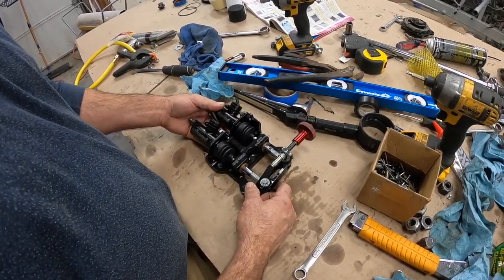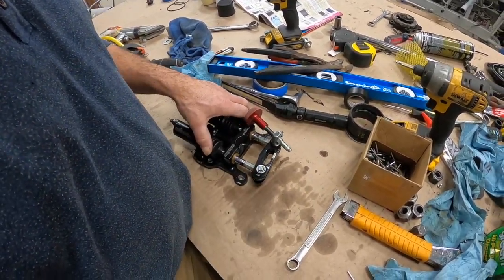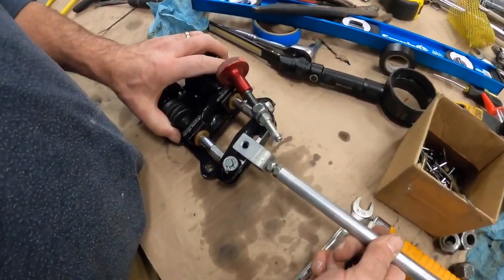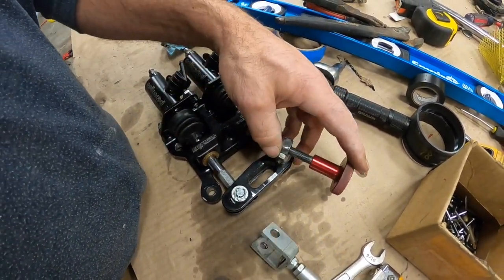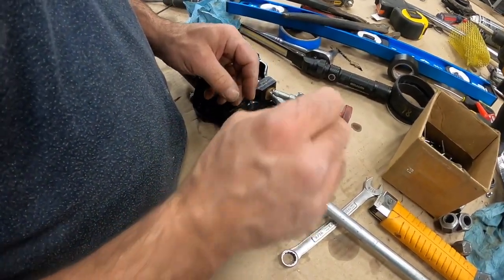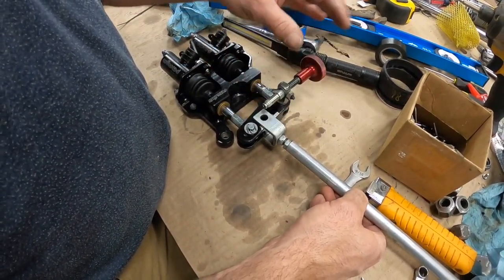It's really consistent, but what happens is, like I found with this one, inside of this here, this is your main brake rod that hooks to your pedal. And when I adjust it, it goes up and down like so, to get my balance front to rear, which we adjust a lot throughout the night. Inside of there, which you don't really see, a lot of guys don't realize, there's a bearing that goes like that, where the bolt goes through. And then this hooks to a Heim joint that goes down through there, which I've cleaned.